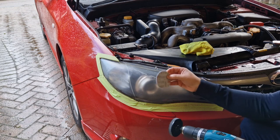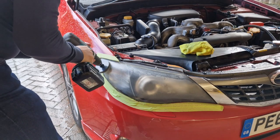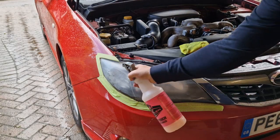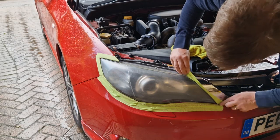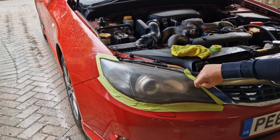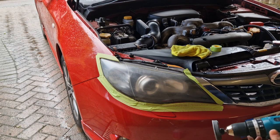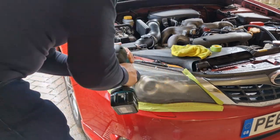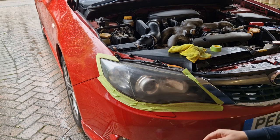This is the P3000 Trizac disc. Hopefully we'll get much more clarity continuing to come through. That's going very nicely. I'm going to up the speed on the drill — I've just masked something off that stands proud of the lens at slower speed, it's easy to avoid, but now I'm moving up the speed I'm just doing that to be absolutely certain I'm not going to hit it. On to the improved speed, same P3000 disc — as you'd expect, that's working really nicely and that's refining down.